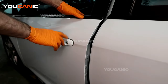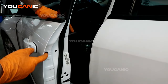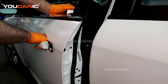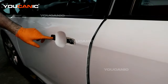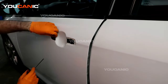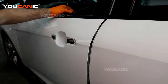You need to remove the door lock cylinder as well as your exterior door handle. To do that, pop this little cover off, put a T20 bit in there, and back out that screw until it stops. You'll be able to pull out the door lock cylinder, then pull the handle towards the back of the vehicle and pull it out. Then we need to undo this screw — we don't need to remove it completely, just loosen it so it'll slide out.